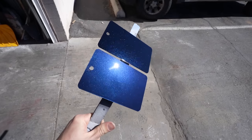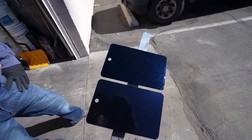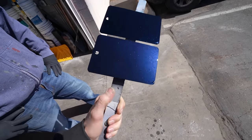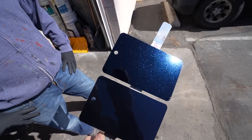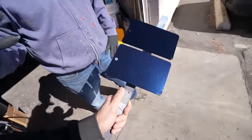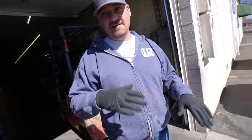All right, so on the bottom, we have the Ford antimatter blue, and then on the top, we just have black base with a pearl over it. This stays sharp and clean. And then you turn this to the side, the OEM color, since all that pearl is in the base coat versus on top of it, it definitely changes the look. It's crazy how the pearl gets so much smaller in the color, versus when it's on top of it, it looks huge. Well, base coat pigments are opaque, so they need to be, for coverage. So anytime you introduce a metallic to an opaque color, you milk it out. Where that is pure pearl, and especially over a black base, it really accents that, brings out that color.